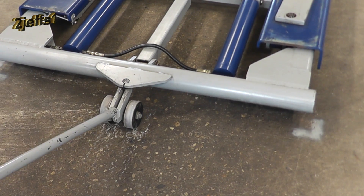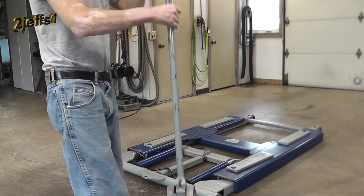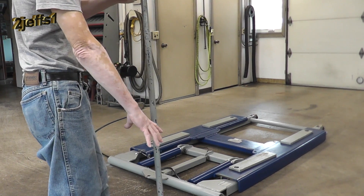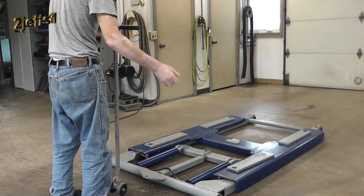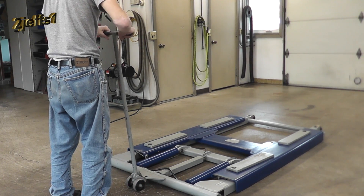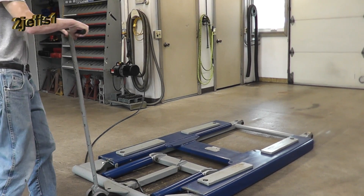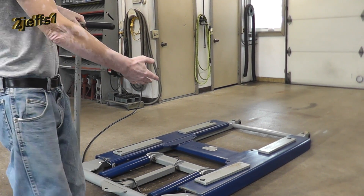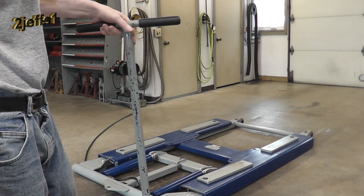Notice how high you can actually lift it. I do like this T-handle setup versus the ones with all hydraulics hanging on it. So if all of a sudden I'm going to get an extended cab truck in here, you just pop this up, move it ahead, give yourself a little more room in the back, and then you've got to drag everything over, unplug it and move it around.